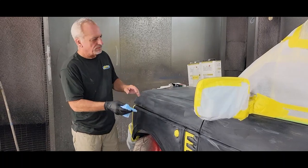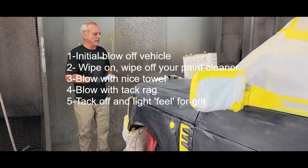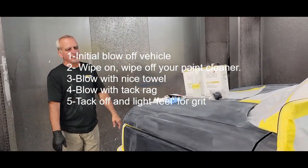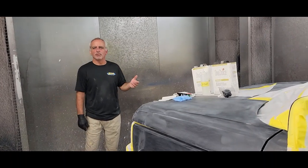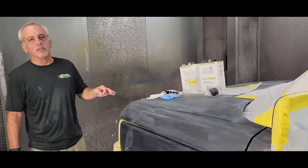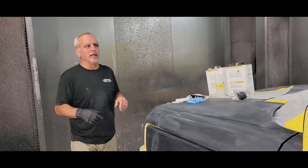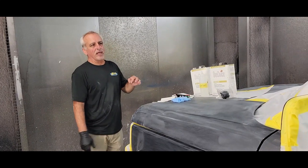That's the process I use to get it to this stage right before paint. It's like a five-step process — takes 20 to 25 minutes, but it makes a cleaner paint job, less buffing. It just makes it nice and neat and gives you confidence that you have a clean vehicle to paint over. I rent my booth out and I've had painters in here that looks like they actually threw sand on it — I don't know how they get that much dirt. Before you even pull it in the booth, blow it off real good. Get all the cracks, open the hood, blow out any areas there. On the roof, some of these vehicles have a molding and they will hold dirt. People don't clean those out or blow them out, and they hold a lot of dirt.